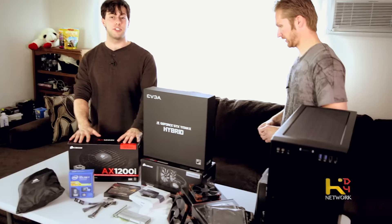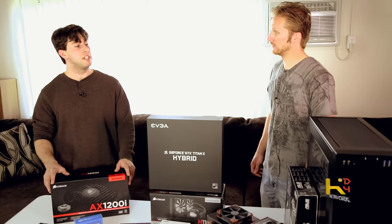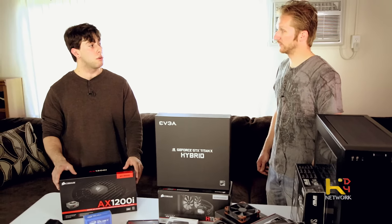It's platinum efficiency — it runs just below 90% efficiency at 10% load and all the way past 90% efficiency at 100% load. That means less current drawn from the wall, which is great because this system is going to pull a lot of power. This smart fan ramping has slowly been coming in across PSU manufacturers like Corsair and Cooler Master over the past couple of generations.